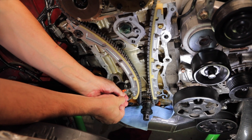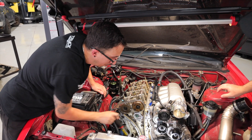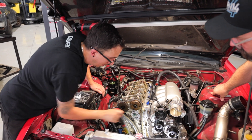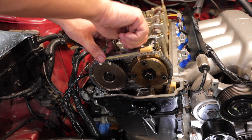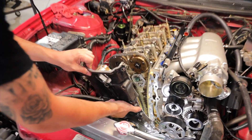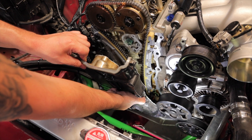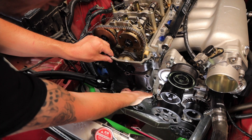The most exciting part of this job. Yeah, there you go. Spin it a couple of times, get some oil pressure inside the tensioner. Before installing the top chain guide and front cover, we cranked the engine over by hand enough revolutions to verify that the cam and crank timing marks were still lining up correctly with those gold teeth on the new timing chain.